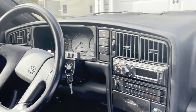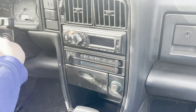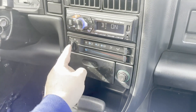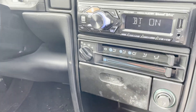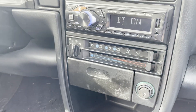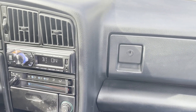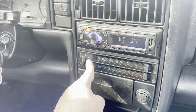I'm sitting in my 1991 Volkswagen Corrado and I want to show something. I'm going to put the key in the accessory position. I have the fan blower on position one and there's nothing, position two and there's nothing going on, position three nothing, and then the fourth position and now it's blowing on high.